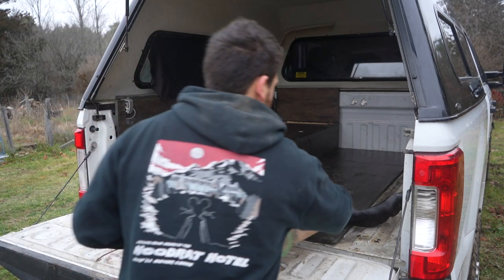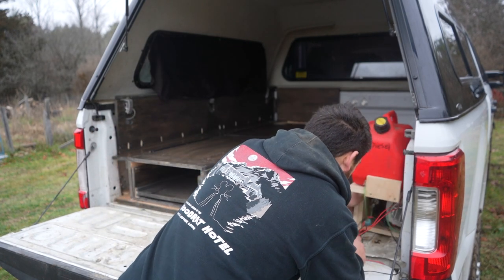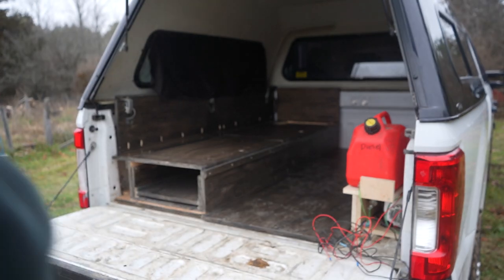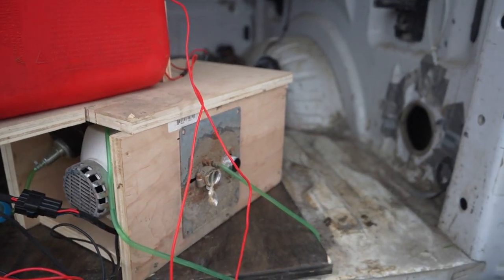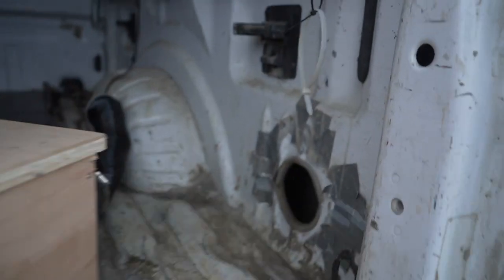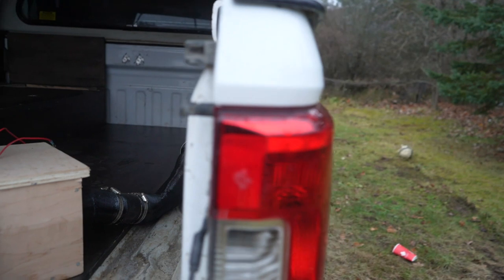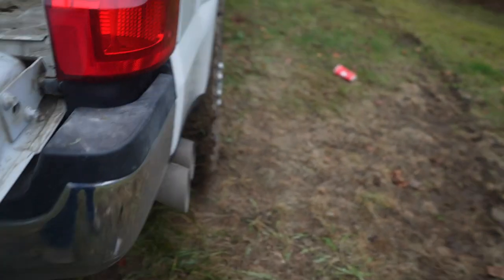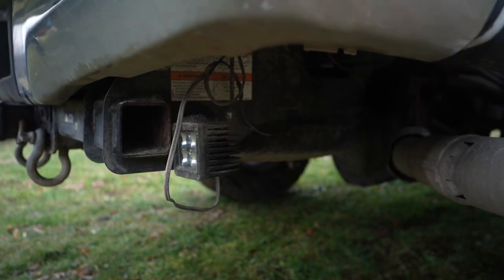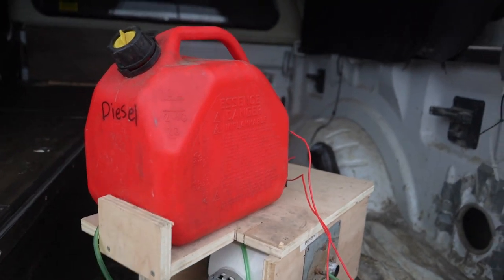For the purpose of this video I'll show you just putting the heater in place — I'm not gonna hook it up right now, but it just goes right there. If you're truck camping without a diesel heater, I'm not sure how you do it, because the dry heat produced from this is amazing — it's quiet and it's pretty safe. I went ahead and cut a four-inch hole inside my truck; you have your exhaust and your intake. I wire the intake up through the walls of the truck, and then the exhaust comes down to the back and typically comes out right underneath here, exhausting away from everything.